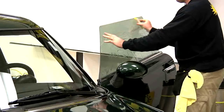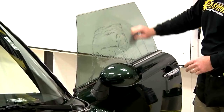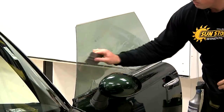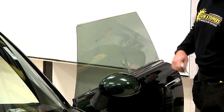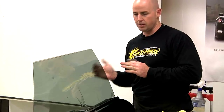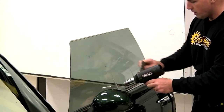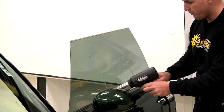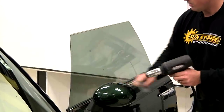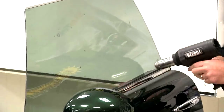I'm going to create what is called tension in the film — in the industry it's actually called a finger, because it kind of comes up from the bottom and points up. The film is a flat surface that comes out of the box, and it has to fit onto the glass, which is normally a curved surface. These heat guns do what is called a mold, where it actually molds the film — it's almost shrink-wrapping the film to the glass, and now you see it fits flat.